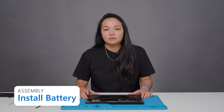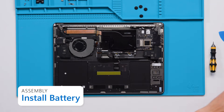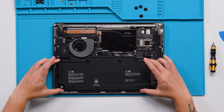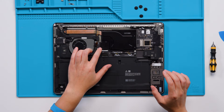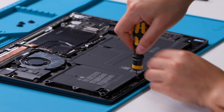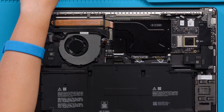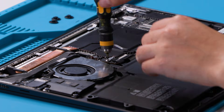Install the battery. Before installing the battery be sure to verify the battery's condition and confirm there is no damage. If you're replacing your battery with a new one, carefully pick it up with the plastic loops that come attached, making sure not to bend or twist it. Always use two hands when handling the battery. Carefully lower the battery into the device. Install eight new battery screws with a 5IP Torx Plus screwdriver. Install the battery connector to the motherboard. Install the battery bracket with two 3IP screws.